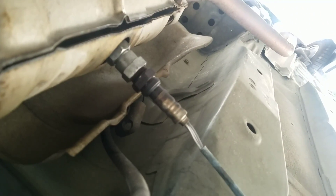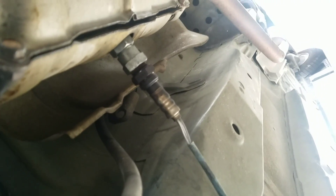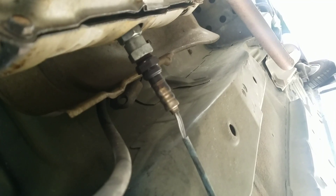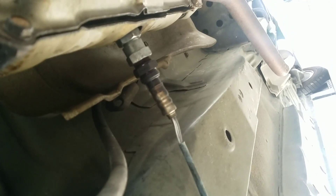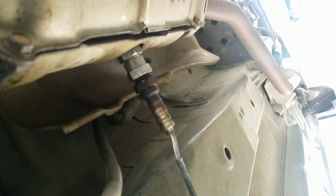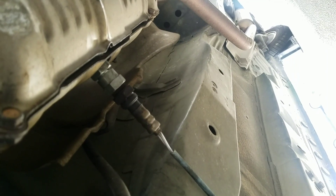Again, if you're in a state where you have an emissions inspection and they look for this, they're going to fail it. A lot of times they don't actually check for it. This car has the P0420 code. If you have two catalytic converters, there'll be a P0420 and a P0430, so you'll do both downstream oxygen sensors. Just tighten everything up and it should keep your P0420 and P0430 codes off.